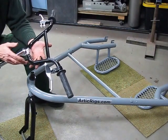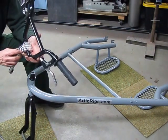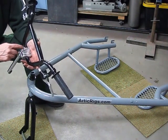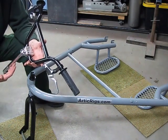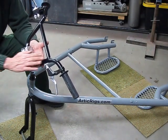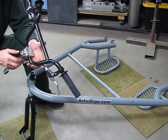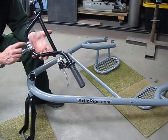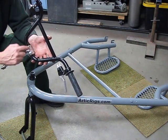Remove your handlebars to take off the packing material. Loosen up the four bolts — this is where your 6mm Allen comes into play. Loosen those up evenly, and make sure they are good and loose when you swing the stem down level with the handlebars. Then tighten these up evenly as you watch your gap in the bracket. Try to keep it even front to back. Tighten those up good and snug.